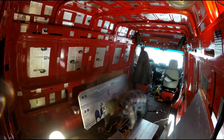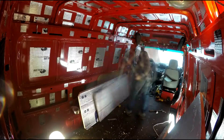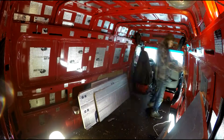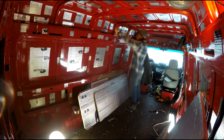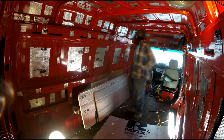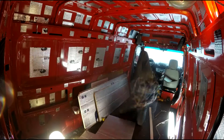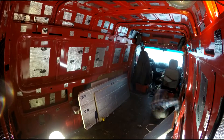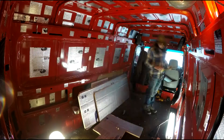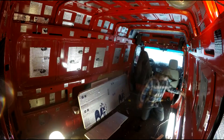it's better than XPS, which is the common pink foam board — the other stuff I'm using here that I had left over from what was in the van when I bought it. Another reason to go with the poly iso is it's got the foil backing, so it also acts as a radiant heat barrier, which probably isn't as big of a deal because the sheet metal body of the van is already probably doing that, but it is something to take into consideration.